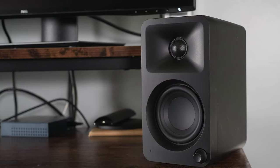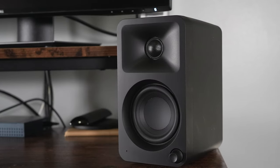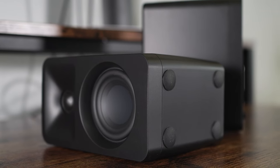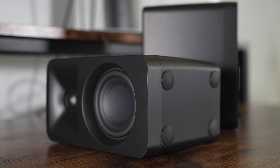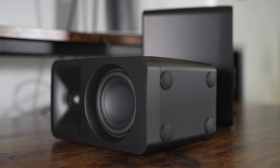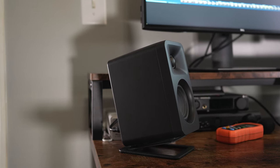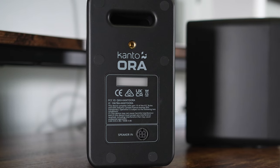They're not perfect. This is a three-inch driver and the frequency will go down to about 60–65 hertz when playing bass, so if you want to go lower you definitely need a subwoofer. The subwoofer output automatically crosses over at 100 hertz, which takes care of that for you. They will play down to about 60 hertz, and honestly that covers a lot of music.